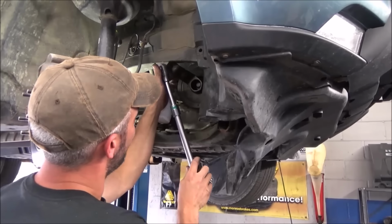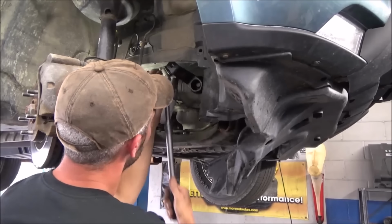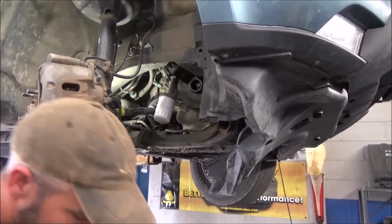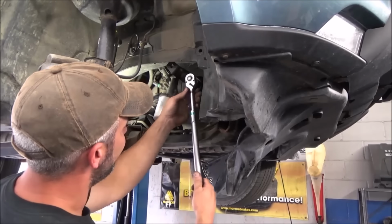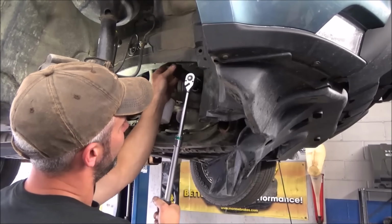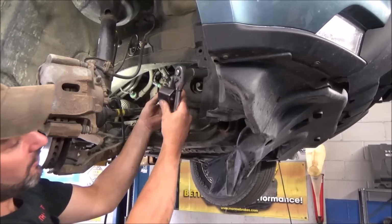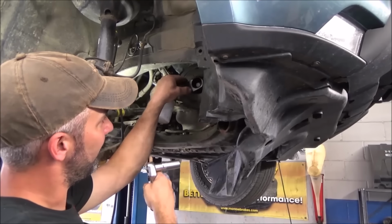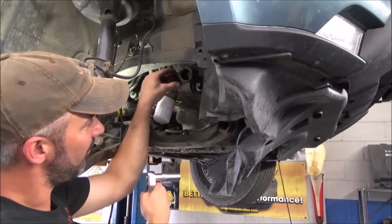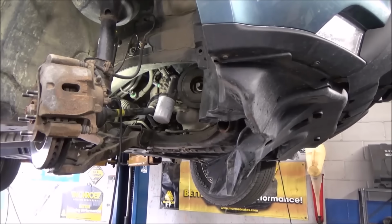And then these crankshaft pulley holders, if I can get this wedged up in there in a minute. No, I have to hook back on the crank bolt. Whoa! They just don't fit that good, at least all the ones I've ever seen, because the hex portion they go into, not only is it tapered, it's kind of a sloppy fit. So these things are always wiggling around. If you got two guys holding bars, it's a pretty good chance one guy's going to get hurt.